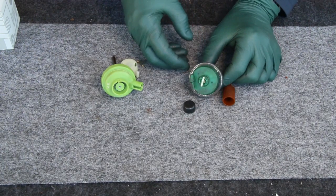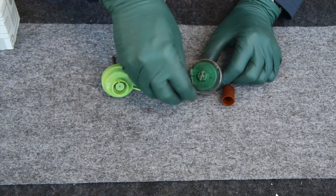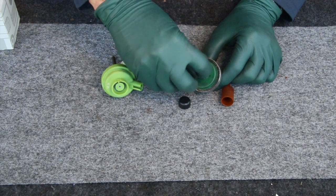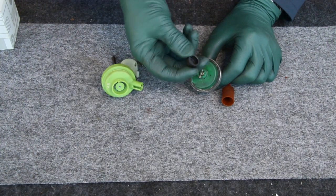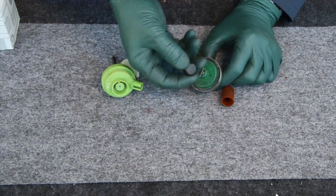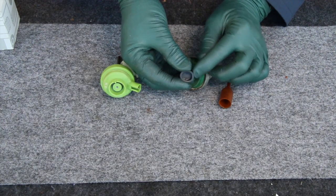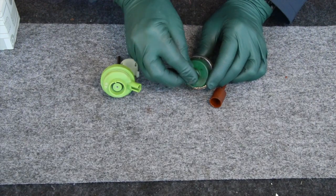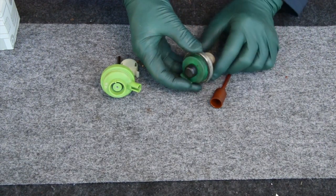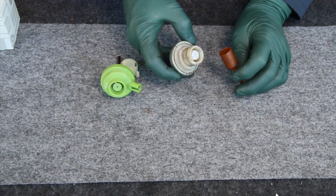The other thing was they just were kind of touchy to adjust. You had to pull this cap off, you had to pull the pin out and rotate it to adjust pressures. And if this cap leaks, then the modulator is going to leak. Sometimes this cap would get old and harden, and it would get rotten and crack. And even though it was secured on the end here, if you were to leak out of this cap, it would affect modulator performance on the transmission.